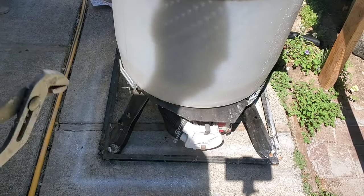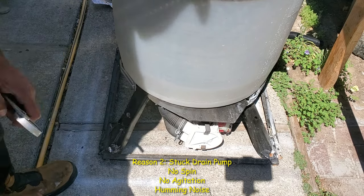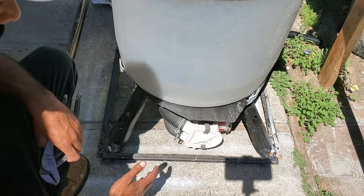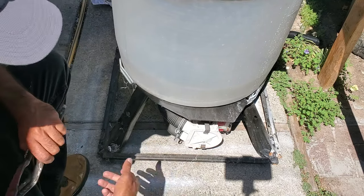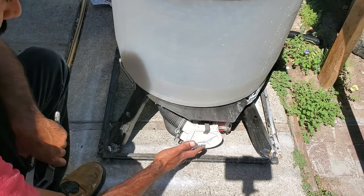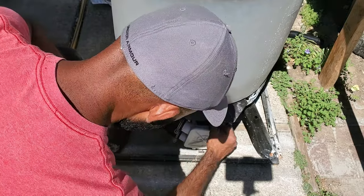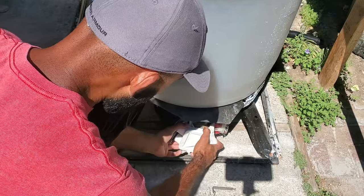The second reason is that there's something stuck in the drain pump. Since this is a direct-drive washer, the motor is directly paired with the pump. I've seen where baby socks get stuck in this, and that's enough to bind up the motor so it'll no longer spin. To check if there's anything in here, all you have to do is undo this clip and loosen up the drain pump to come right off.